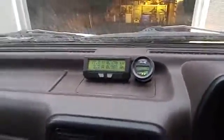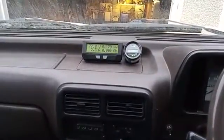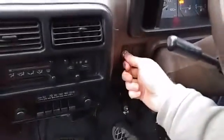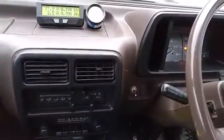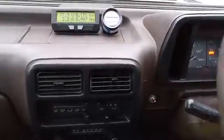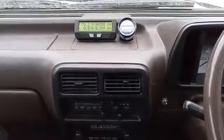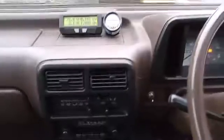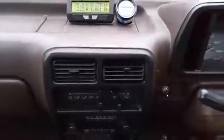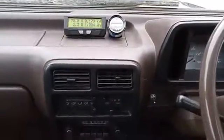So that's to make sure it does not bake the heater cores if you have them on and the fan off. One thing to keep in mind, you need to have this switch off before you shut the truck off. Just because of that safety circuit we've had in there, if you have this on, for some reason the truck doesn't always shut off correctly. I don't know, it's just a weird little thing. Occasionally it's just a gremlin, but it's easily solved by making sure that switch is off when you shut the truck off, so no issues.